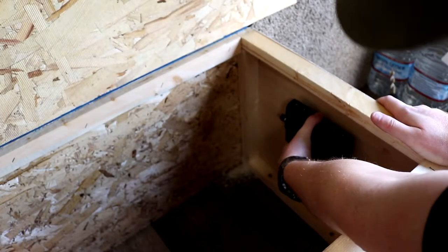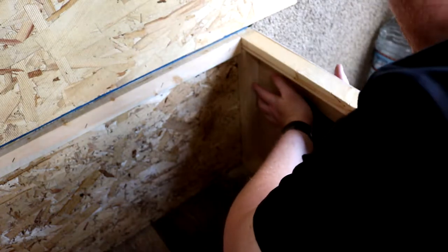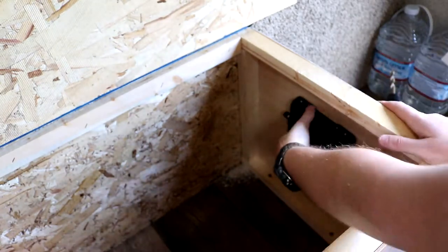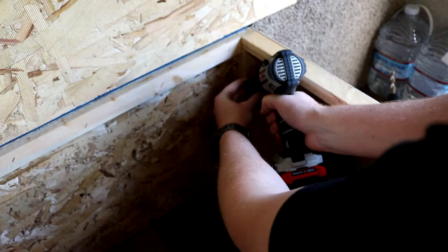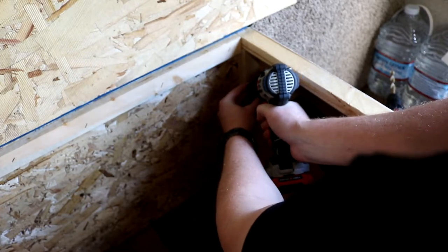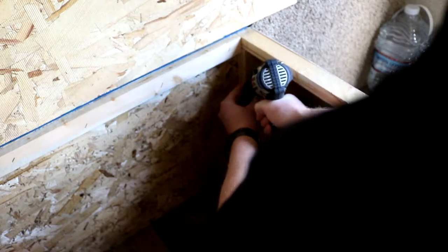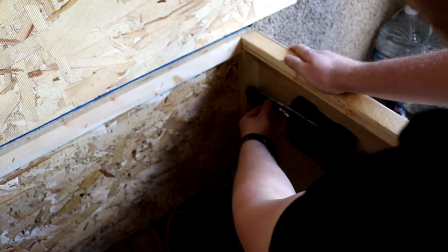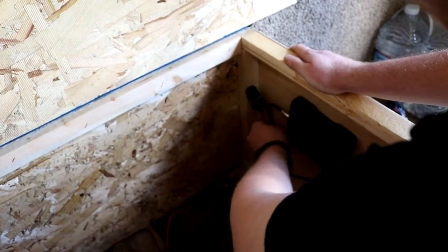And then the first thing I'm going to do on the inside is right underneath the bed, I'm going to go ahead and mount the booster with a Velcro backing so I can also move it if I want to in the future. And then I'm going to go ahead and screw in and mount the 12 volt plug adapter right there to the side rail next to the unit. And then I'm going to plug in the first extension cable for the antenna, for the exterior antenna.